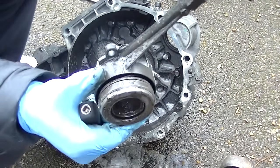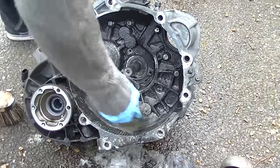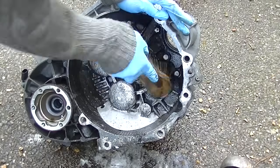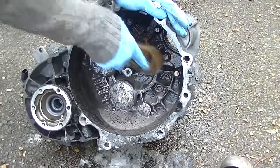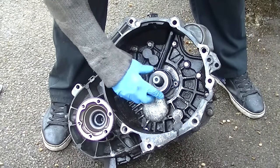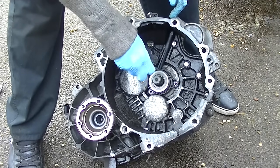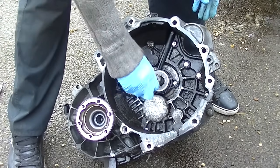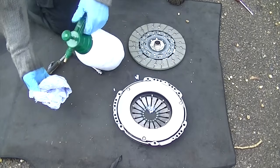Pull it out and replace it — it should come with your clutch kit. I'm cleaning in there with a wire brush, scrubbing it up because I don't want any of this stuff getting onto my new clutch. You're not going to get it brand new, but a little effort goes a long way. Check the input shaft seals to make sure they're not leaking. Replacing the concentric slave is simple — it's held by three 9mm bolts. I'm not sure of the exact torque specs but you can find them elsewhere.